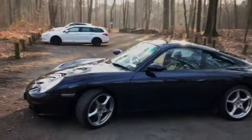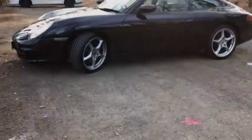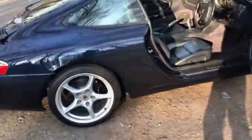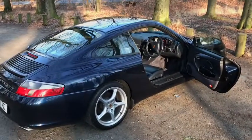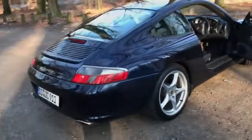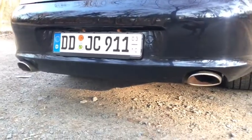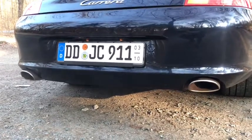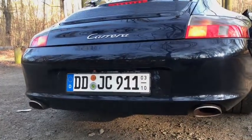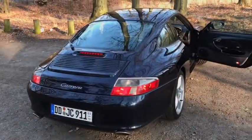The paintwork's in pretty good condition — I've got a little bit of work to do here and there, but otherwise it's a fantastic car and I love it. I'm going to try to get a video of me driving so you can see the roads around here and hopefully hear the exhaust. It's got the Porsche switchable exhaust — the PSE — which works. Well, it's on all the time at the moment because there's a servo on the left bank which has stopped working, but I'm quite happy it's stuck in the on position. It sounds absolutely fantastic, really an amazing sound.